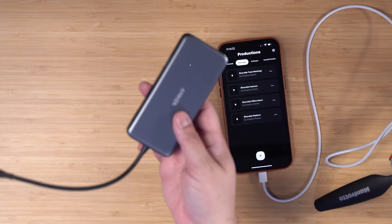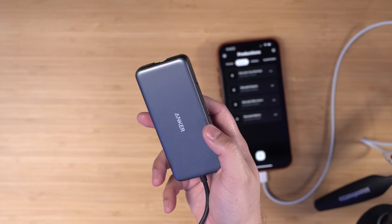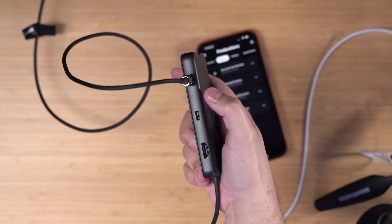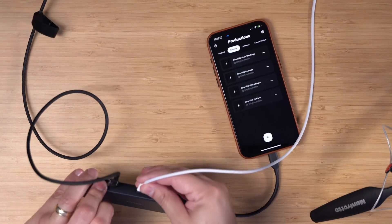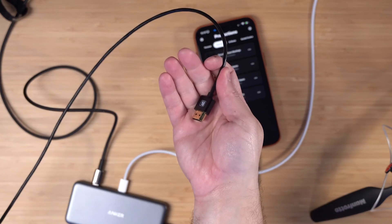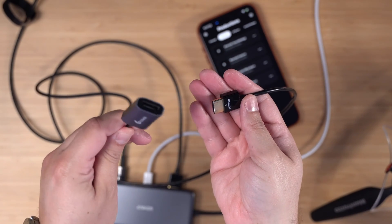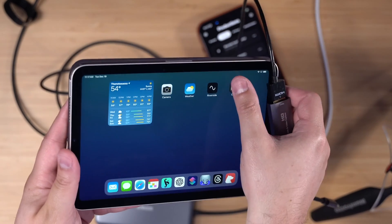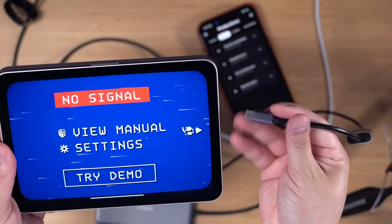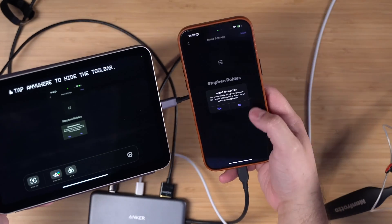For a more advanced setup to use the rear camera on your iPhone for even higher video quality, I'm going to use a USB-C hub — this one is from Anker, it has multiple USB-C ports and an HDMI out, and it can charge your iPhone while you're recording. I'll plug power into the power delivery port to keep the iPhone charged, then plug the USB-C microphone into the other USB-C port on the hub. Next I'll take an HDMI cable and plug it into the HDMI port on the hub. The other end goes into an inexpensive HDMI-to-USB-C capture device — you can get one of these for about $20 on Amazon. Then we'll plug this into an iPad with USB-C.